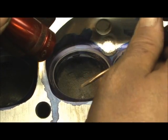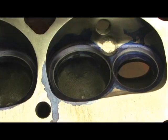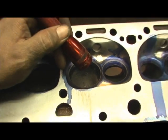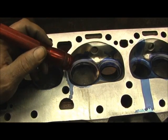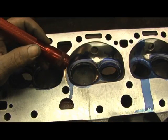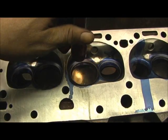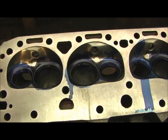In order to make the rest of the bowl pull into that, I've got to go back in there and chop a considerable amount and return some of that short turn radius. Because all the action is happening up near the top, I'm not going to have to go back in here with that old 40-grit paper and go through that living hell again — boy, that will wear your arms clean out. But I am going to be able to go in there and get the lines and make a nice roll right into it.